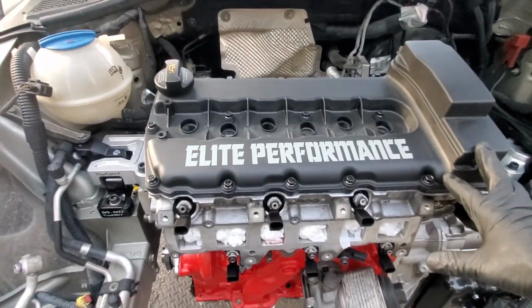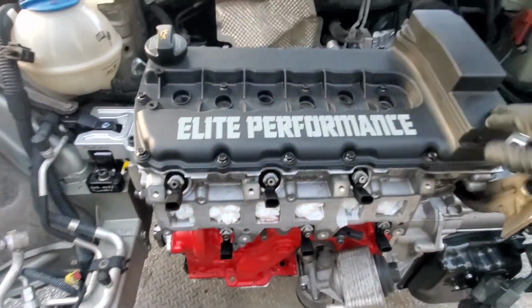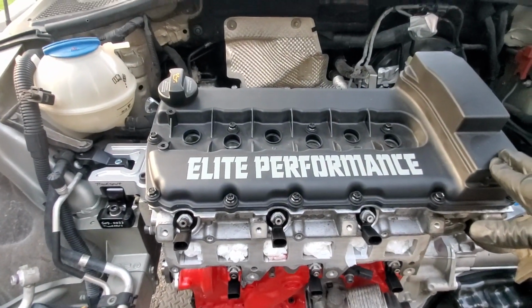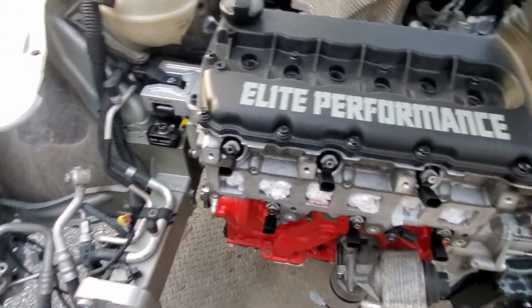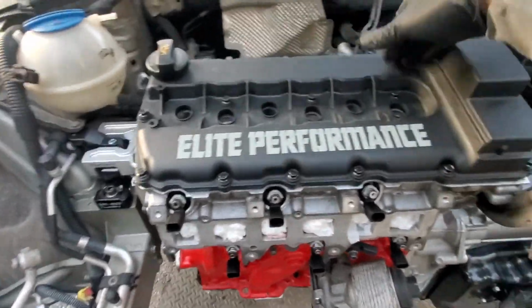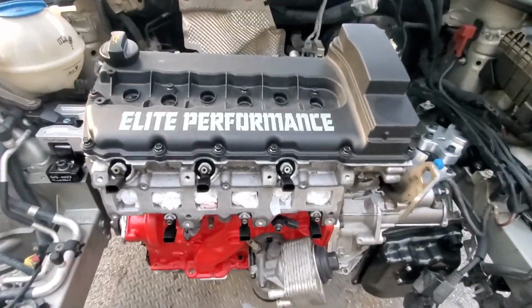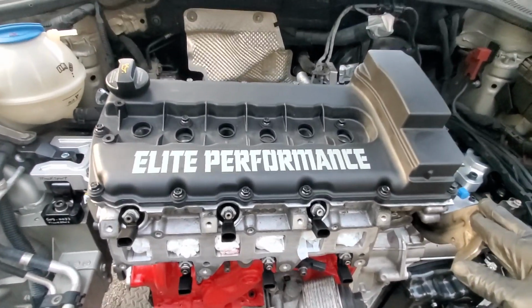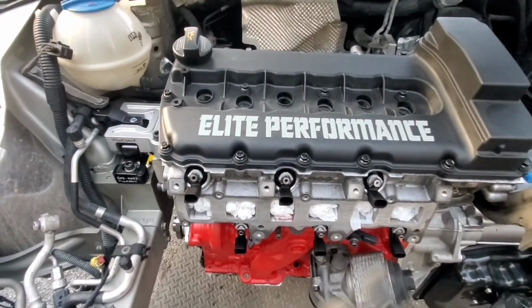If it's 10 psi boost on the back side of the intake valves, all of them are going to see the same psi boost, even if the runners are staggered, which they are. You have cylinders on the back of here, which is 1, 3, 5, and 2, 4, and 6. So boost pressure, but when you're running a bigger turbo, possible turbo lag, hence you need that volume to suck from, that volume of air.